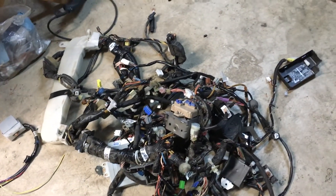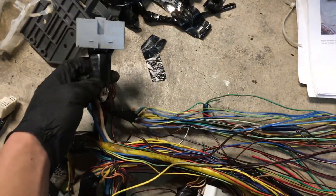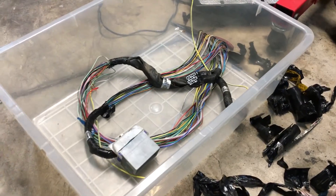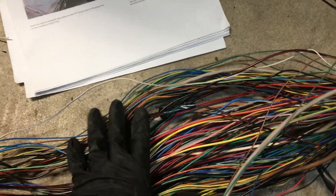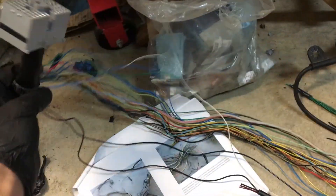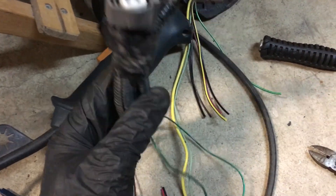This is what we kept and we have this to work with. I'm taking a break for the day but I just want to show you what I did. So I went from this SMG connector - that's what's connecting to that harness right there that goes to the engine. I took all the tape and plastic off. There was a white plastic piece that covered this, and what I did was I pulled this, and anything that wasn't leading to the ECU I just kept pulling and snipping, because I'm trying to bring this back so it's only this harness. There are also these plugs - this is for the transmission, the O2 sensor.